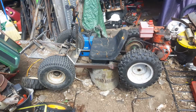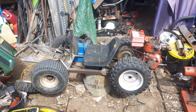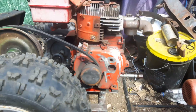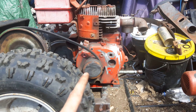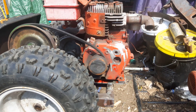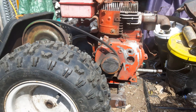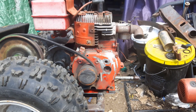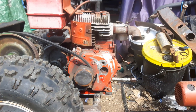So that's where it's at. It should be done pretty soon, maybe tonight even, and then there'll be some videos of this thing running. The engine is an H50 — an old school Tecumseh 5-horse, actually a big block. I believe they make around 8 horsepower for real instead of 5, and the newer ones actually make 5 — that's at like 3,600 RPM. If this doesn't work, I have an 8.5 and an 11 also that are both snowblower Tecumseh engines, the HSM 8.5 and the HSM 110 or whatever they call it, the 11-horse.